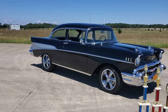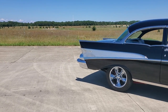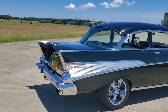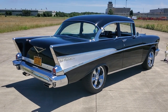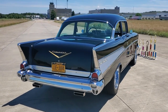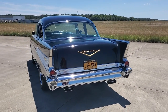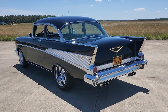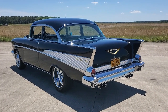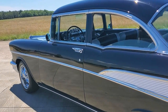I've had it for 19 years. Off and on, I've been working on it. Finally got it done. Paint job was just finished about a year and a half, two years ago. All the chrome is original except for the front and rear bumpers — all the chrome has been re-chromed. It's got disc brakes all the way around, a Ford 9-inch in it. The underside of the car is painted just like the top and polished also. It has air conditioning, power windows, power disc brakes, 383 stroker motor, turbo 400 transmission, aluminum drive shaft, and the car probably has 150 miles on it since it was finished.